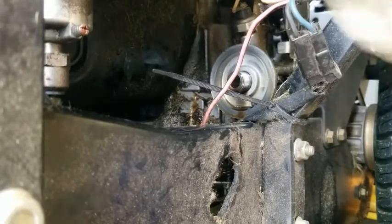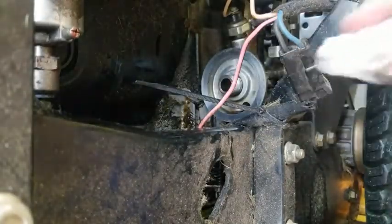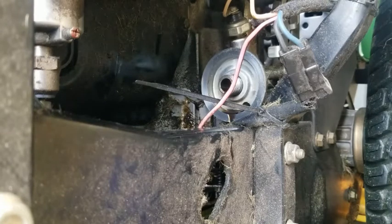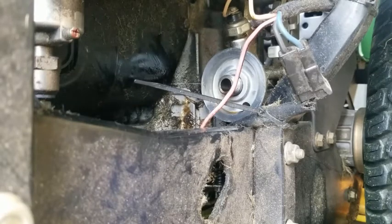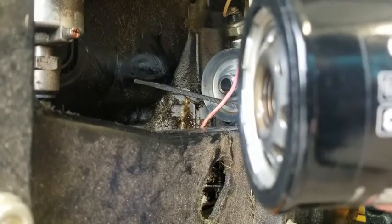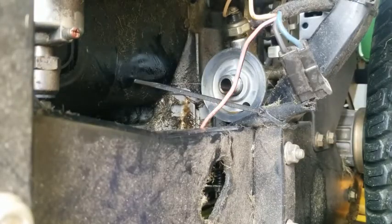You can see where the old oil filter came off — make sure you wipe this surface clean. You don't want to get dirt in there. The oil filter I've been using is the Parts Master brand, number 61394. You can get those at Lee Auto Parts or Bumper to Bumper depending on what it's called by you. When you prepare the new filter, I always pour a little oil in the top, then take my finger and get the gasket all full of oil before I put it on.